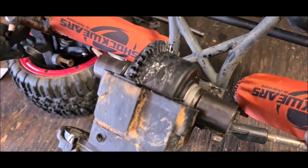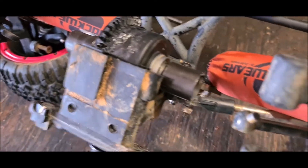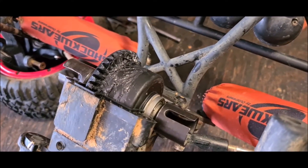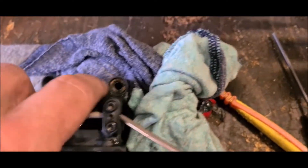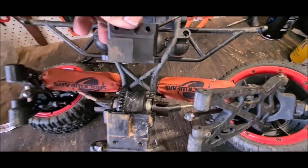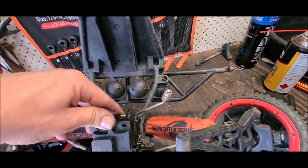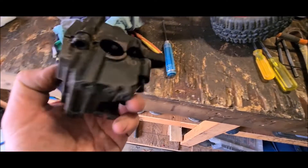It was a little bit low on fluid, so I topped it up - seemed pretty clean still. Cleaned it all up, put new grease on there and she's good to go. To pull this out it's really only the two bottom bolts and two top ones, and the whole thing comes off as long as you take the sway bar bits off. Pretty simple.